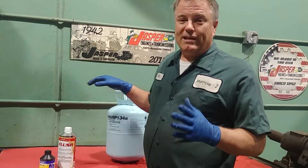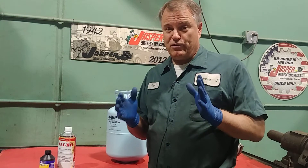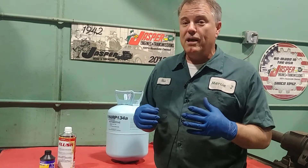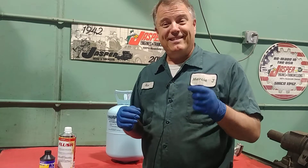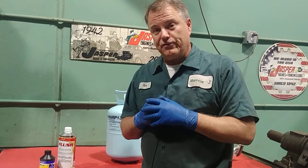Well, first of all, let's talk about how to know exactly how much Freon's in the car. There is not much refrigerant in most of our modern-day automobiles. Unless you have a big system, like in a van or something, we only have about 16 to 20 ounces. If we have too much in there, it's going to damage our compressor, especially here in Phoenix, because our temperatures get so high and it puts the pressure really high on that compressor.